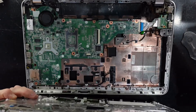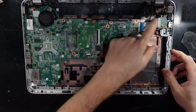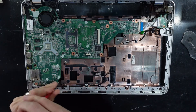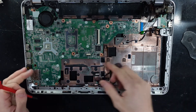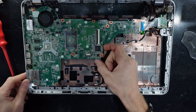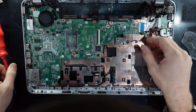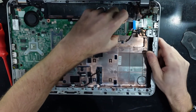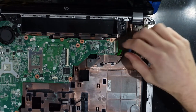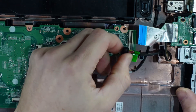We are now in. Now that we're in a bit further, I can't really see many signs of damage. The mainboard will also be able to come out fairly easily now. What I want to do is disconnect the DC jack and try a different one. I'll zoom in to the hotspot, which is right here, and I should just be able to wiggle this back. I've got a spare so I'm going to go check that out.